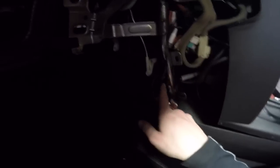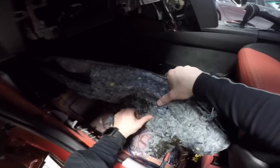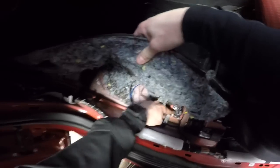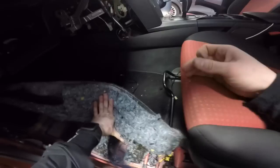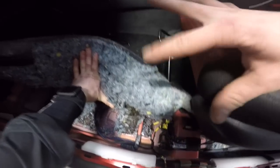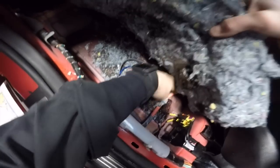So the RCAs are coming out from behind the head unit, ducking down inside this wee hole here, where they come across. And if you can see under here, here they are. They're under the carpets, so they won't be felt by the user or by the person in the passenger seat. This big red one here is the main permanent power supply for the engine coming from the battery. Now, it won't be a problem being too close to that, as long as it's not in parallel with it for too long. So it comes along and goes about maybe 20 centimeters that way before it curves off.